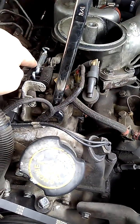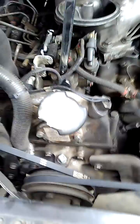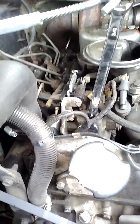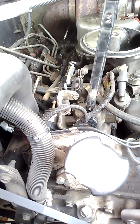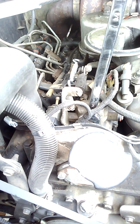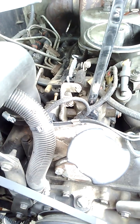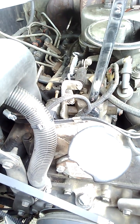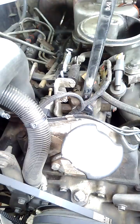I'm not a professional by any means — it's just how I learned and what works for me, from lots of reading on the forums. Make sure your pump bolts are tight when you're doing your test, make sure it's at 2,000 RPMs, make sure the line's clean, make sure no wires are hanging. If there are any other questions, feel free to contact me or comment. Have a good day.